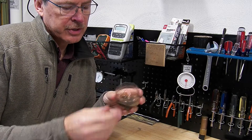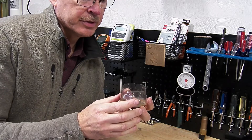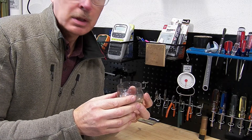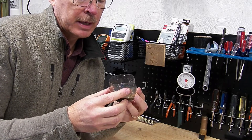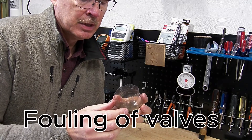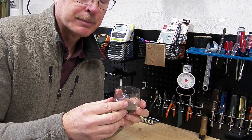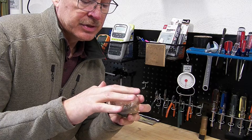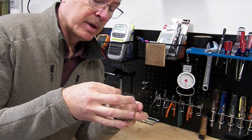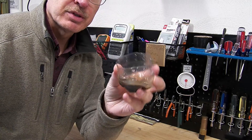What we're looking at here is a collection of the fluid that came out of the right-hand side, or low-pressure ventilation tube. This normally would have been put back into the intake and caused a lot of fouling on the intake valves and injectors. So I think it's worth it to run catch cans, but again, only on the right-hand side. This here is discarded, but there's a fair amount of moisture, oils, and gasoline in it — it's a pretty foul mixture.